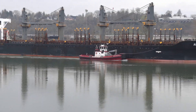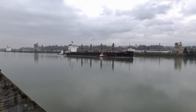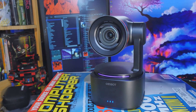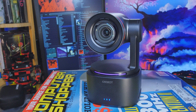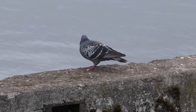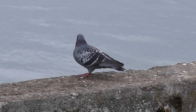Optical zoom is interesting because it's more like a traditional lens — there's compression and all that. But the other zoom is essentially cropping in on the sensor. I'm using my background blur, but I can turn it off and there's still a little bit of background blur back there. That's because our lens is f1.8, but it's not as crazy as a full frame sensor. This has a one over 1.5 inch CMOS sensor. These numbers always confuse me, but just know this is almost the biggest sensor you're going to find in any camera like this. There are some out there with one inch sensors, but I kind of like this one because it looks really, really good.